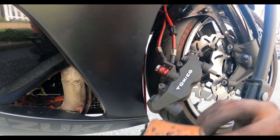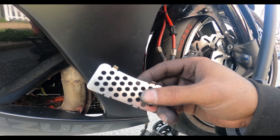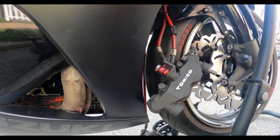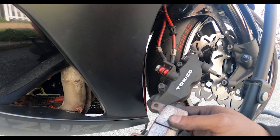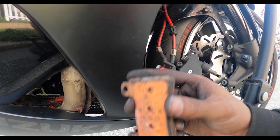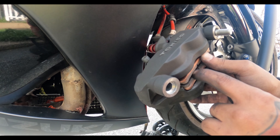The old ones are out. Now, these came with shims in the back but they don't fit on the new brake pads — they're too loose, so I'm not going to use them. When you do have the old ones on and they're squished together, you want to push back the pistons. You do it while you have the old ones in — get a flathead screwdriver and stuff it in between there and push.